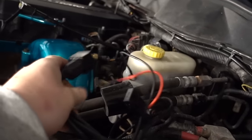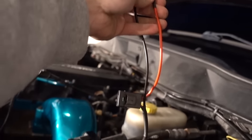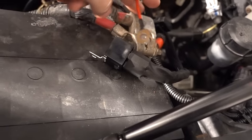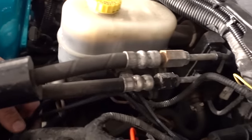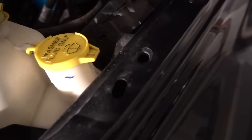So you've got this relay and a short lead to get to your battery — positive and negative. I ideally want to mount this somewhere here where all my other electronics are, but by the time I reach from the negative to the positive, it doesn't really give me enough room, and that's why I end up usually lengthening or shortening all these wires. From the relay, you can see how much wire they give you to go all the way to the light, which I'm not going to use anywhere near. So long story short, I'm going to end up shortening and lengthening a lot of this stuff to get it exactly where I want to mount everything.